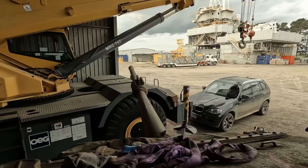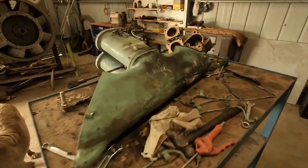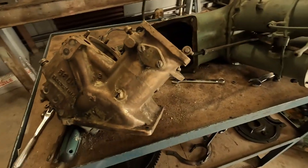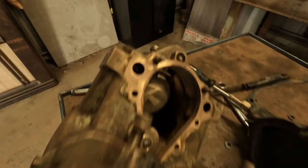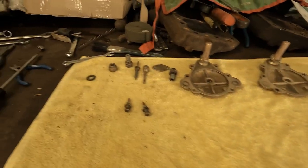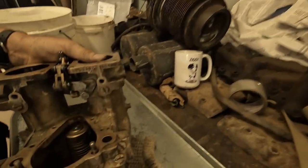Other than a few modifications she was left exactly as we had last seen her in Queensland. Needless to say we had a lot of work on our hands. Naturally the first thing we did was replace the carbies. Upon closer inspection not only were the carbies leaking, but they were also filled with a preservative. This preservative had clogged up much of the internals preventing proper operation even if it wasn't leaking.